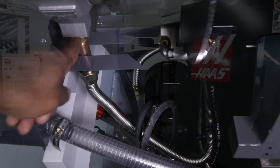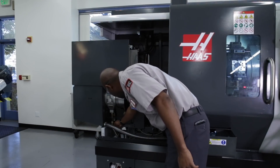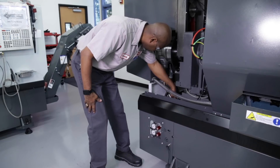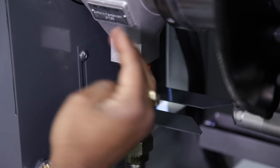This is the return line. First, check for obvious causes of blockage and look for kinks or sharp corners in the line. Next, check the union itself around the return line threads and make sure there are no damage or cracks of any kind.